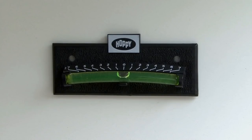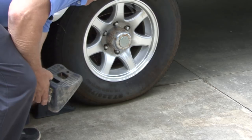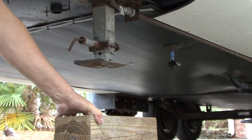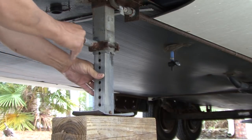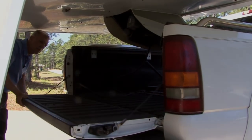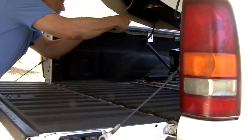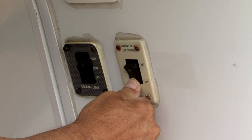Complete any leveling from side to side on the site prior to un-hitching. Make sure the truck and trailer are on a level surface. Chock the trailer wheels to prevent any accidental movement in either direction. Place some blocking under the landing gear legs and lower and secure the fifth wheel landing gear. Lower the tailgate. Disconnect the light cord and the breakaway lanyard and stow them so they are out of the way. Raise the jacks until the weight is off the hitch plate.